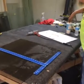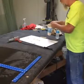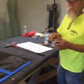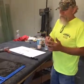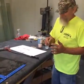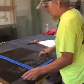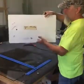I've got my cutter, and I've got a little oil on the cutter here. So I put the cutter back in the oil, and I work my hand on it to make sure there's no chips in there. And these are all tips coming from not an expert, but I've gotten pretty good at it, so I'm not breaking glass every time I do it. I had my pattern. I traced my pattern. This is for our Model A coupe.